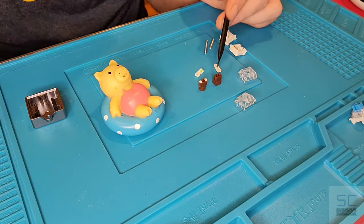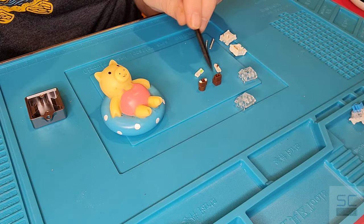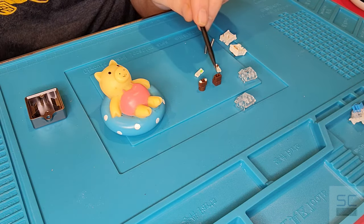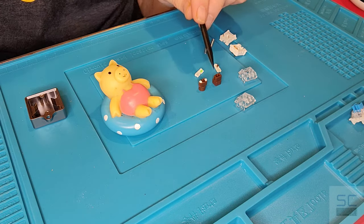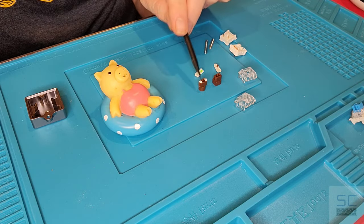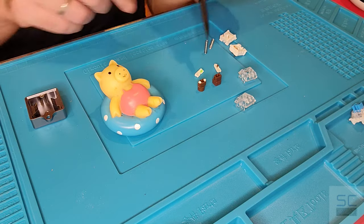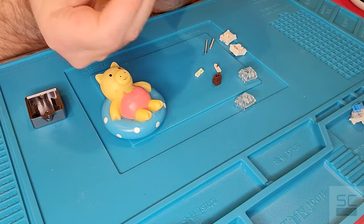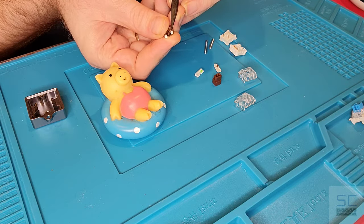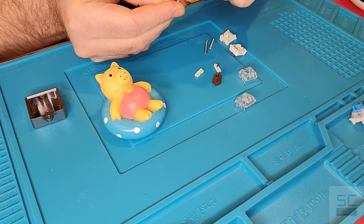So Kailh went ahead and did something really smart, which is they made little inlays in the switch. And this is actually one of the reasons that this is round as opposed to this is square. I know that I said that they didn't really have anything to do with it, and I kind of lied, because they do give the extra room to embed the dampeners so that they just stick out a tiny bit there. And you can remove these if you're brave enough.